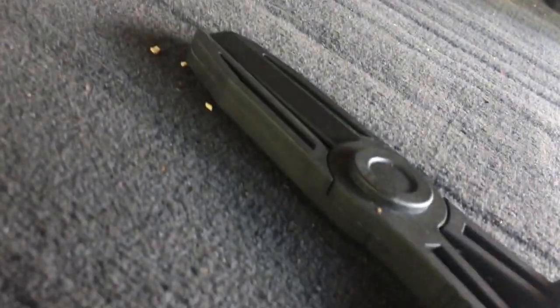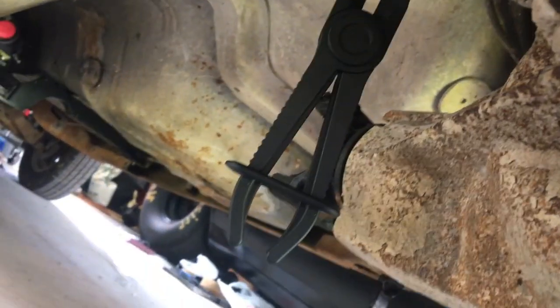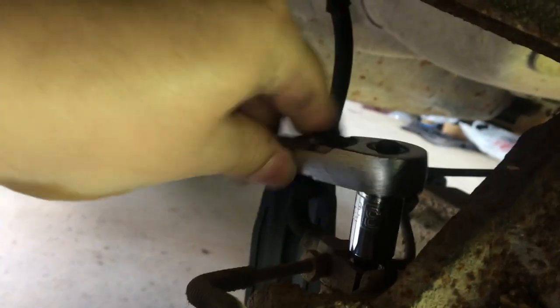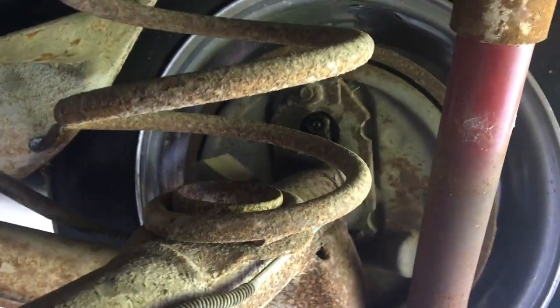I went with the medium-sized one, tried the large as you saw. Neither one of them really closes it up - maybe because the hose is old, maybe because they're just not really that good. Anyway, we'll see how much fluid starts pouring out once I break these loose off of the wheel cylinder. I ended up putting two clamps on it; I don't know if that'll make any difference. I sprayed the brake lines going into the wheel cylinder with a little PB Blaster and letting them set - we'll see how this works out.